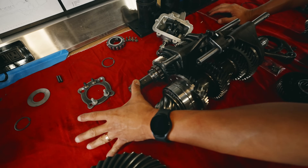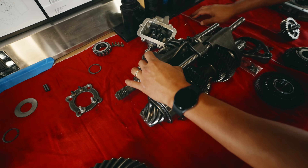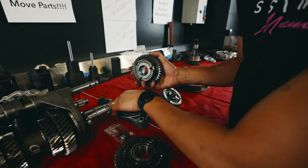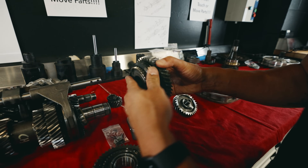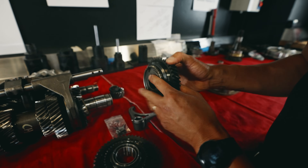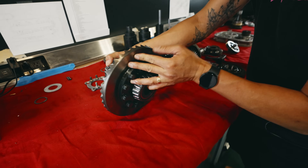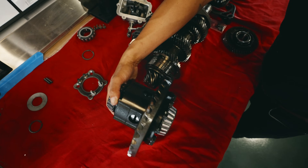This is attached to another shaft that goes to the clutch. So you have the engine turning the primary shaft, rotating all these, and then what connects it are the shift forks sliding the synchros. As it slides, it locks in the gear — this is spinning freely normally and then it locks it in. Once it locks it in, it spins the output shaft onto the diff. And the diff translates this to the wheels.